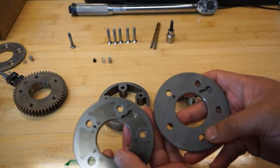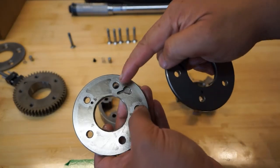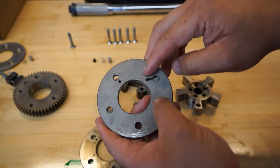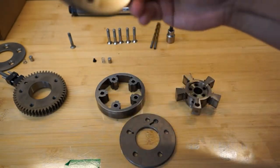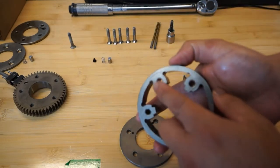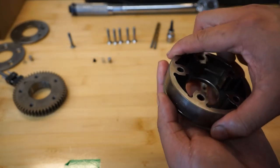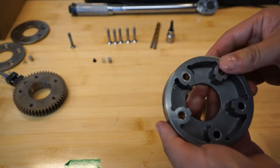Cross-reference your lock plates and make sure they match — the lock key is between the two holes and the spacing is on the right for exhaust. The locating dowel on the back side of the housing matches up with the female end on the lock plate. Squeeze and it should be quite snug.